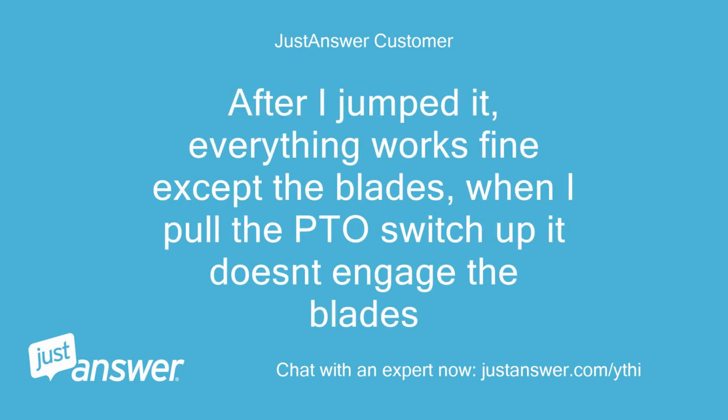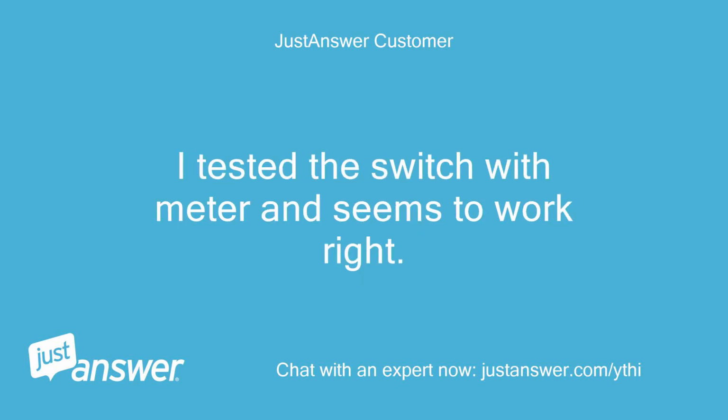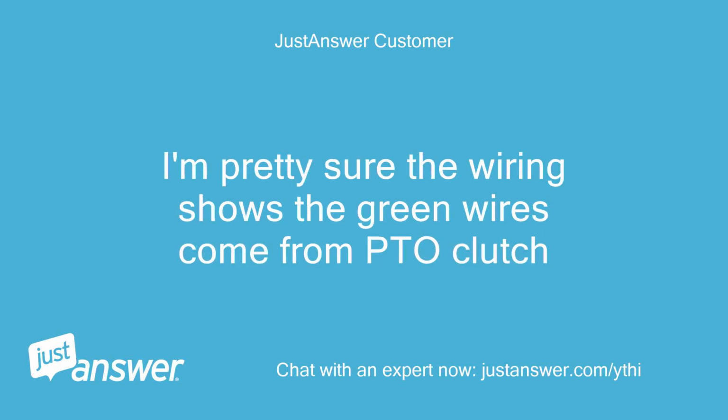After I jumped it, everything works fine except the blades. When I pull the PTO switch up it doesn't engage the blades. I tested the switch with a meter and it seems to work right. I'm pretty sure the wiring shows the green wires come from the PTO clutch.